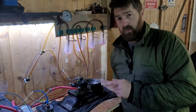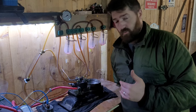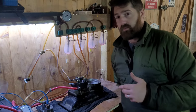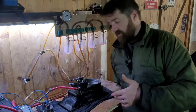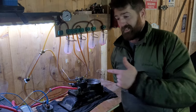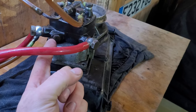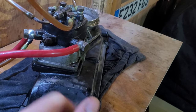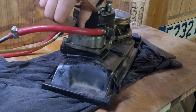It's a very different setup to the previous 16-valve units where you've got two different seals - this is just one seal and a spring. I'll pull it out and show you exactly what it is, because if you haven't got your system pressure building up, you haven't got fuel coming out the injectors. System pressure is vitally important. The system pressure output is here - the 14mm nut is already cracked off, so we'll take that out and see what's inside. There's no fuel pressure in it, that's already come out.